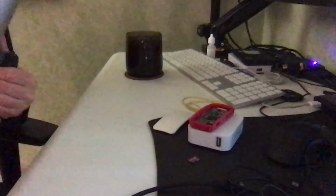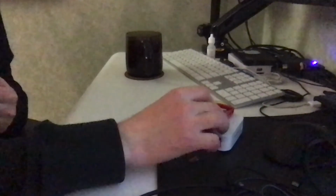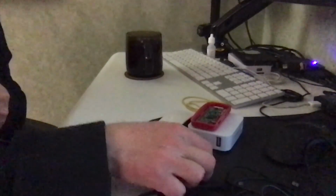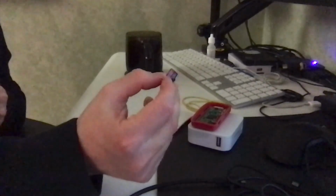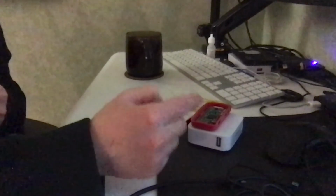You will plug it into your Raspberry Pi, and what it will do is share the internet. If this cable is connected somewhere to the internet, working as an uplink, basically, it will share it over the wireless network. So you connect to a wireless network and you have your internet access. So that's what the access point is, and basically, yeah, it's a wireless router. So you can turn your Raspberry Pi into a wireless router, but I don't need that in this scenario. So what do I need? I need the Raspberry Pi to have its own Wi-Fi network, but that's about it.